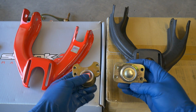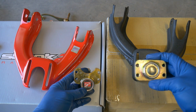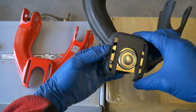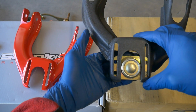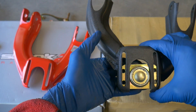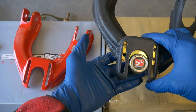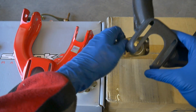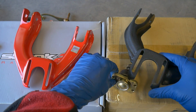When I have an opportunity to get my wagon aligned — probably in another video — I'll ask the alignment shop to push the camber kit all the way out so we can see just how much camber it's correcting. You only have a certain amount of adjustability on this camber kit, but it's still going to correct a decent number of degrees. Sometimes you're only correcting one to two degrees, and that might be exactly the difference you need. You can see how much further the Skunk 2 arm goes in comparison. That's the only thing I think is missing from the EFparts.com arm so far.